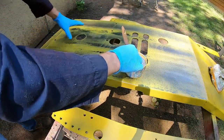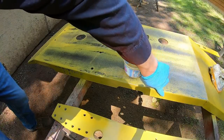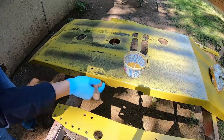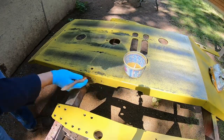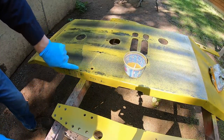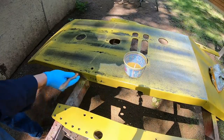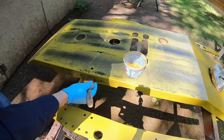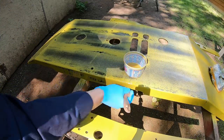We did the whole top side of it first, and then we let some of those mineral spirits just run down the side, and they sat on there for a while. So now we come back with some fresh spirits on the side, gently go over that, and you can see where all of those runs are turning into vertical marks now. That's just something else that's really hard to recreate if you're trying for that, but you just let gravity do its job. All those details start coming into play.